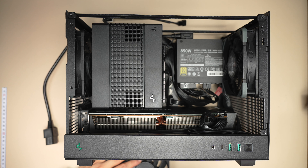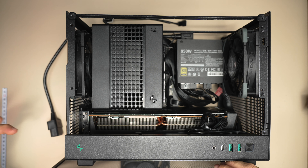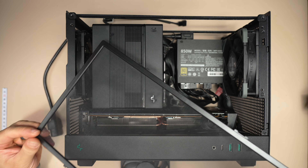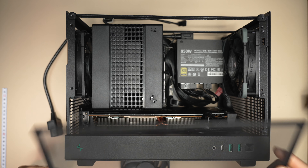As for dust management, if you intake at the back you can get a magnetic 120mm fan filter — I'll leave a link below — and pop or screw it onto the back of the case to solve that problem. If you intake at the back and exhaust at the front or top, you don't necessarily need the front or top mesh panels, and they're easily removable if you don't want them. I will be doing a full build guide for this case, so please stay tuned, give a like, make sure you're subscribed — thanks for watching.